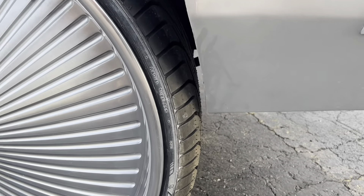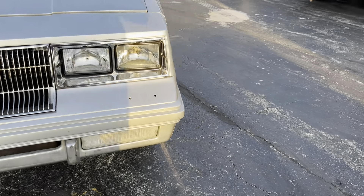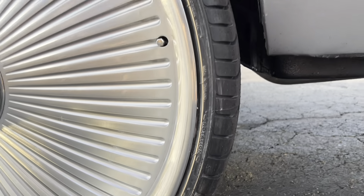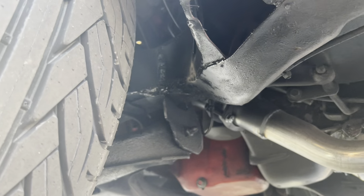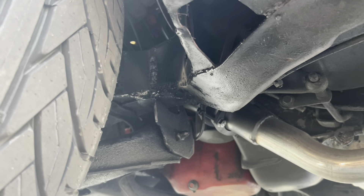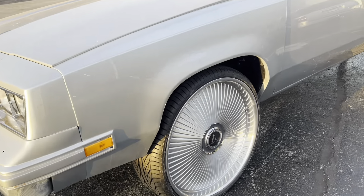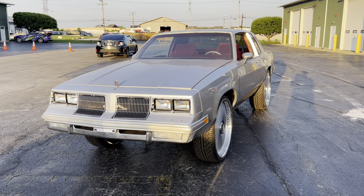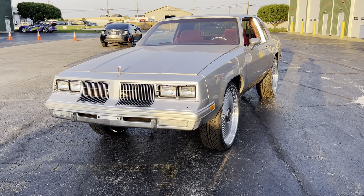I cleaned all the way up into the little control arm well — where nobody else does it — they do that damn step notch in there and then the control arm hits it. So I cleaned it up and painted it. We put All-Star ball joints in the front which allowed getting the camber up and down, and it's got plenty of travel in the front, so it rides smooth. My son just drove it down the street — he liked it, the steering wheel went straight. The spindles are degreed just a little bit so there's a little bit of sport steering.